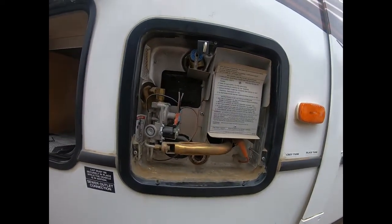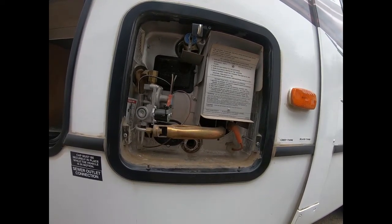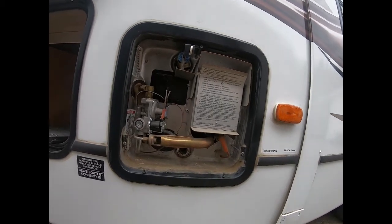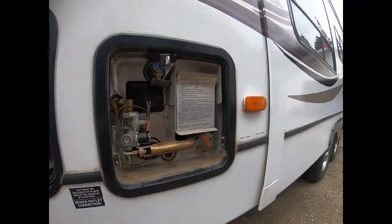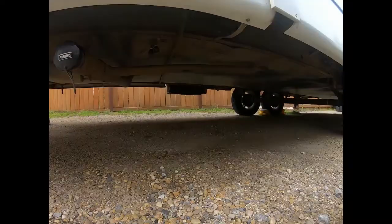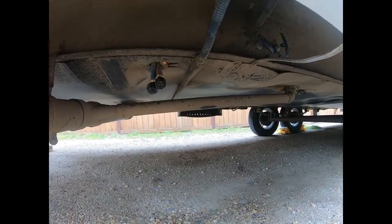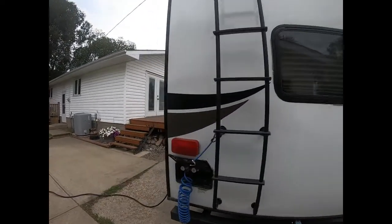So from here, we're going to go and set it up from the inside and get it ready to start winterizing here through the pump. Run all the antifreeze through the lines, through the faucets, taps, and into the drain traps there. And then there's two ends that are under the trailer here, under your hot water tank, that we'll open up at the end once we're done to make sure we are drained. All right, guys, I got a couple things set up here.